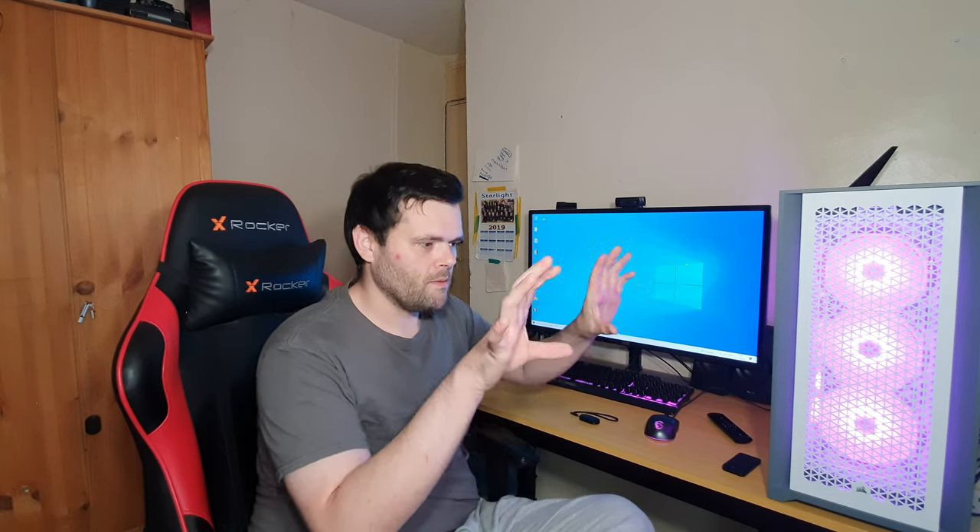So my choices were limited. The Lian Li Lancool Mesh doesn't support a 280mm radiator — it supports 140mm fans but not the radiator, I think because it's not tall enough where the CPU cables are. On my left side are the CPU cables and where the radiator comes down with fans attached, since I blow air through the radiator to save on dust. In my old case the 280mm was always catching, but in the 500D the motherboard tray is low enough — it fits perfectly.